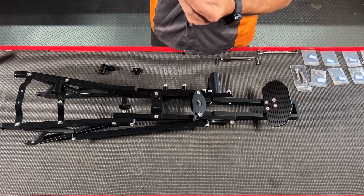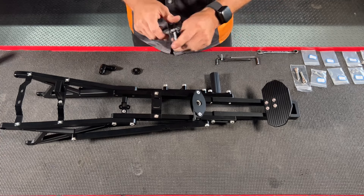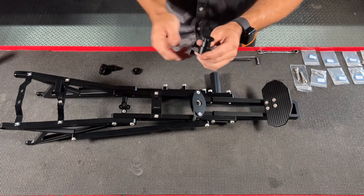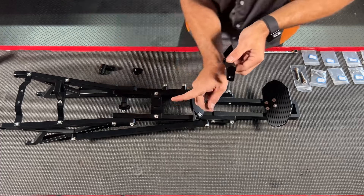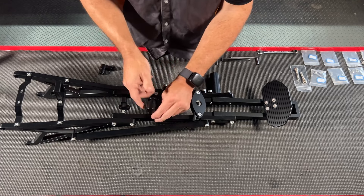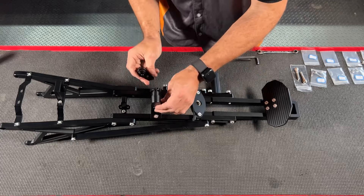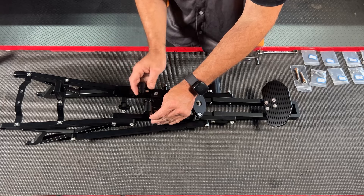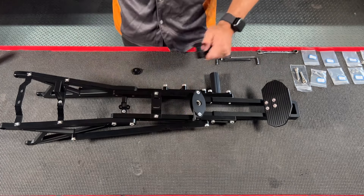The brackets slide into the seat, then put the thumb screw in place and screw it down tight. Then you bolt this onto the battery area where the battery lid connector used to be on your Surron frame. You can see this bracket is notched — the front of the bike facing this way, you want the notch leaning forward. This side mounts on the subframe and the other side mounts on the Surron frame where the battery lid used to mount. The seat bracket sits between the thumb screw and this bracket, allowing the seat to still swivel upward when unlocked so you can pull your battery out or service the bike.